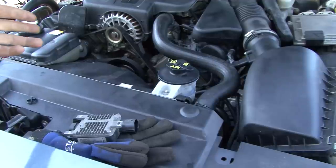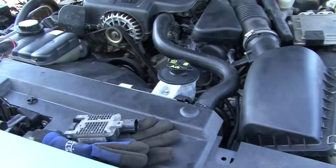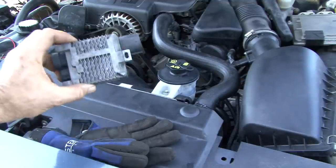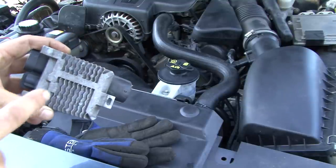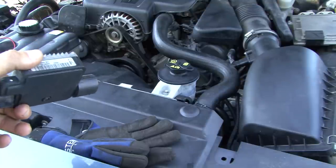With the car running, you can actually hear the fan kicked on — you can feel the breeze coming up through there. Just that simple, that's the fix for you guys. A little bit of troubleshooting — you can get one of these modules online and change them out. When you change out your fan, it's a good thing to change out your module at the same time. Hope that helps you guys with 1159 Videos.